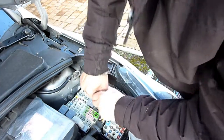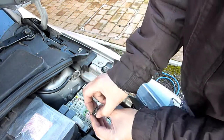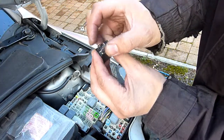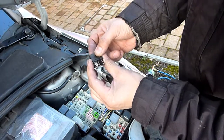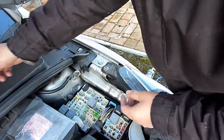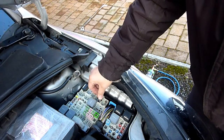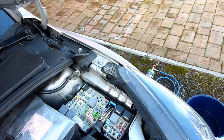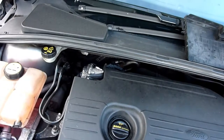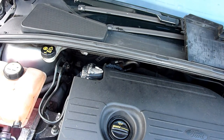Remove the relay. Two small ones are the control pins; two big ones are the ones you need to bypass. Put the wire across those now. As soon as I put this in it might spark. It also means the aircon will be on regardless, which is what we want — because it wasn't turning, now we'll be able to get refrigerant in.